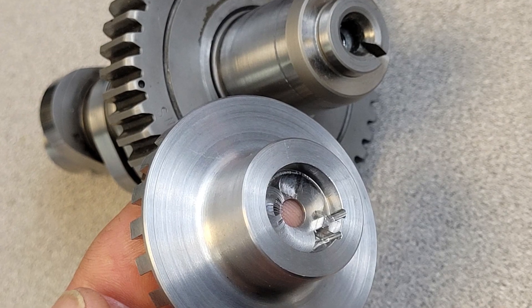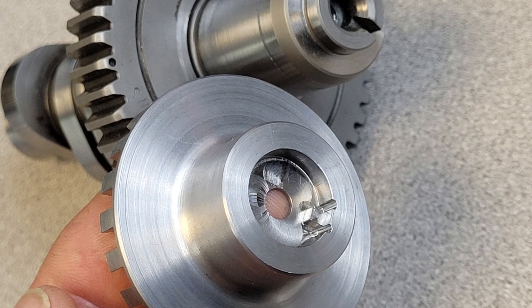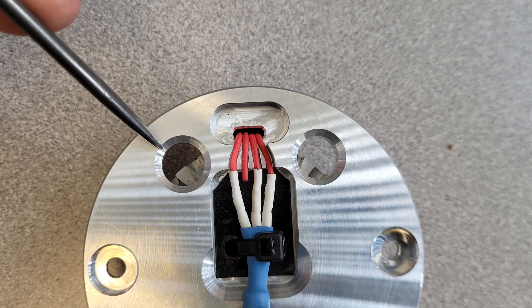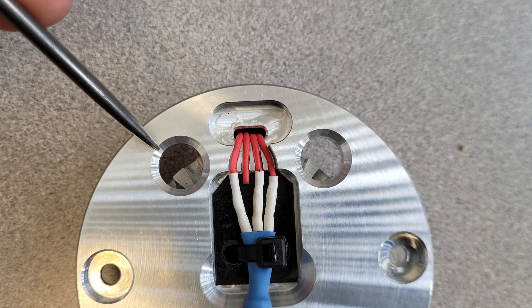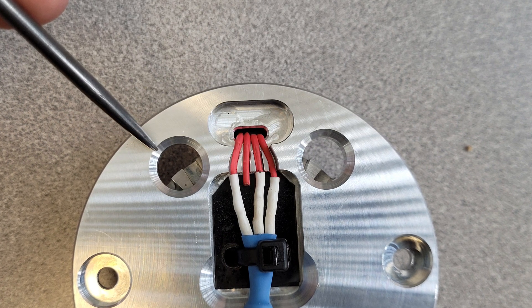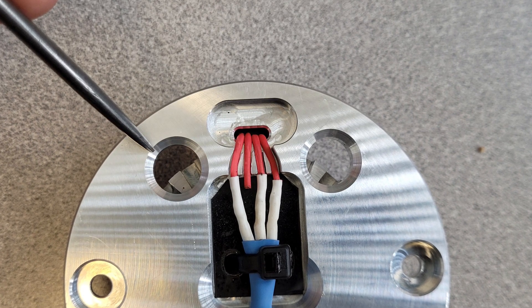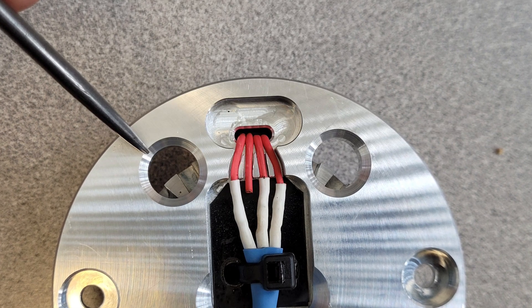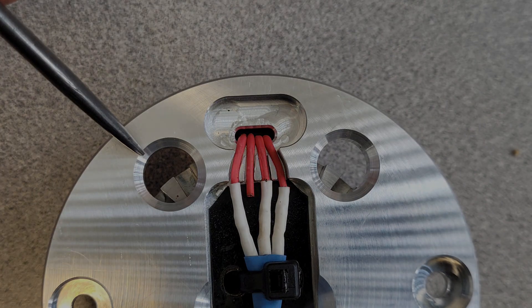On the backside of the wheel there is a small protrusion that fits in a notch at the end of a camshaft, providing correct positioning. The purpose of those two holes is so the builder after installation can inspect and check the clearance between the backside of the mounting plate, the sensor, and the trigger wheel. The recommended air gap is about one millimeter, so it is important to inspect and make sure there is no issue with that.